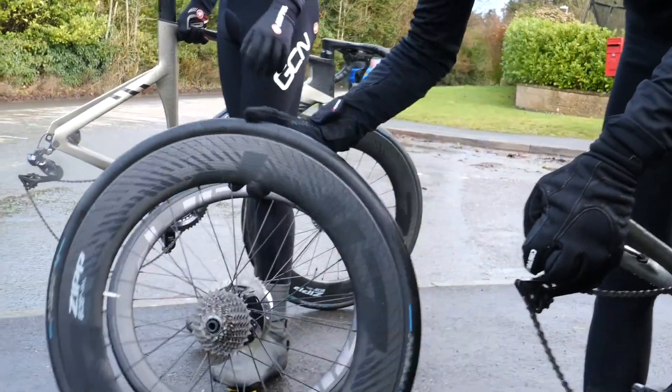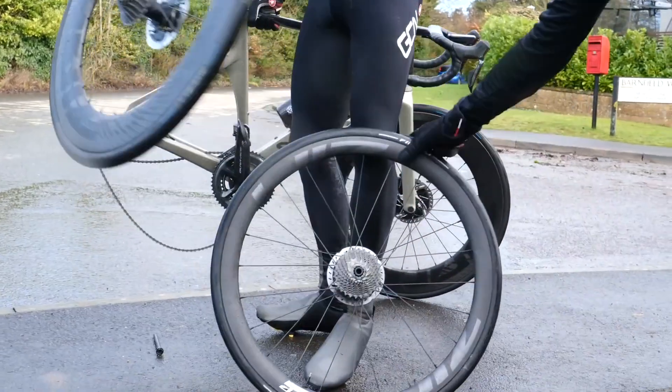In terms of spacing the disc out: that is possible if you're using a six-bolt rotor fitment. If you're using a Centerlock fitment, you're not going to be able to adjust that. On a six-bolt rotor fixing, you do have the option of spacing the rotor out very slightly using some incredibly thin washers, but it's quite a tricky process and not the ideal thing to do. Simple answer: you're going to have to live with a little bit of brake rubbing, unless you've got six-bolt rotors, in which case you can try to space them out to account for the different wheel sizes.